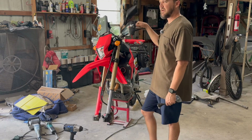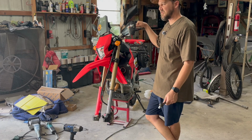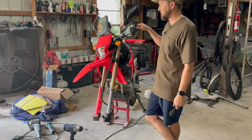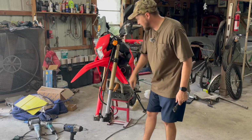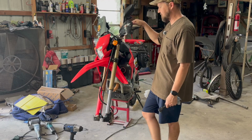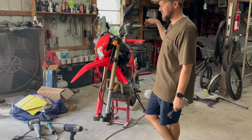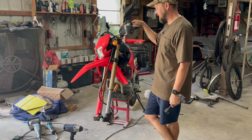So I was already in my head, thinking when I get home, I'm going to pull a couple of washers out and see if I can soften it up. Well, when I got home and saw that, I said, well, that actually works out. We'll kill two birds with one stone. But this suspension doesn't have the adjustable valves on top or anything like that. You've got to disassemble and remove washers and whatnot. On the back, I have the Cogent shock, and you can adjust that one. But